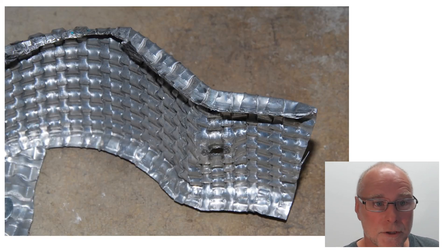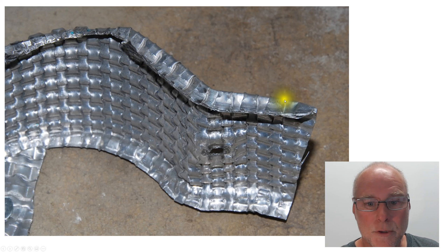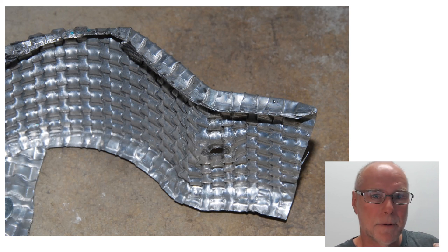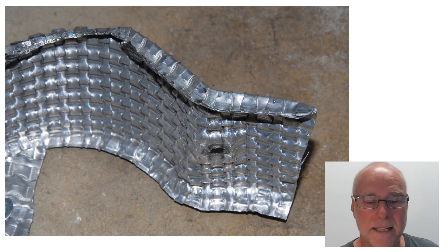To show you what you can achieve, here's a curve that matches the shape of the turbine with a rolled flange, which allows me to connect it to other pieces and also helps hold it in place. It was formed over — I don't remember exactly — maybe 30 minutes, just using those tools: the dolly, the edge of the bench, and a normal lightweight panel beating hammer.